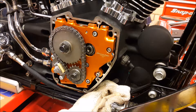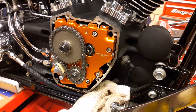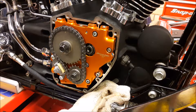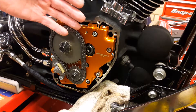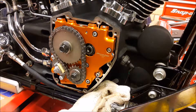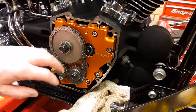Just a quick update on where I am with this at the moment. As you can see from the picture, the bottom end is now finished. There was nothing really major in that — it's really a case of correct fitting of bearings to camshafts and then correct fitting of bearings into the plate cam timing, which in all honesty is pretty straightforward.